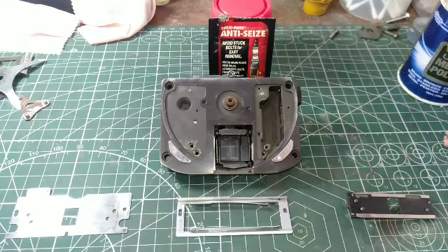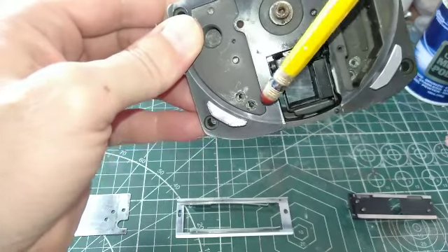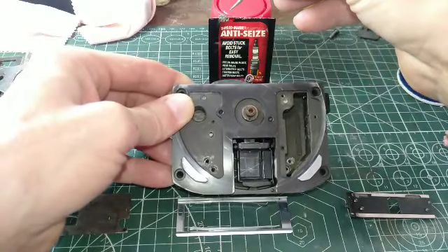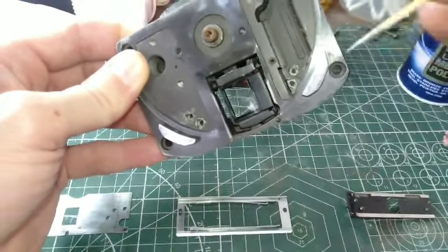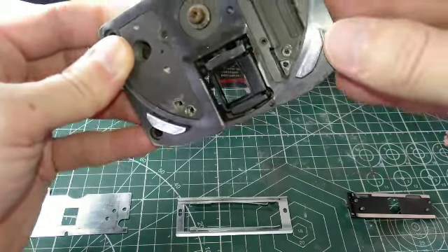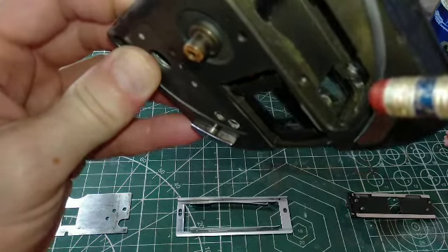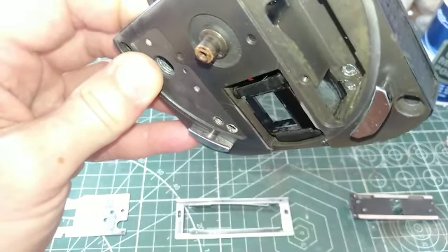Getting ready to apply these plates and leaf springs — that requires the rust to be removed from the screws. On the turret here, I went inside at the screw hole positions — one, two — and in the transport prism holding area — three, four — applying some anti-seize on a toothpick for rust and corrosion prevention. If you're doing this yourself, do be careful up in this area because your transport prism is going to go in there. You also have two more prisms there — very thin ones — so you don't want to get anything on those.